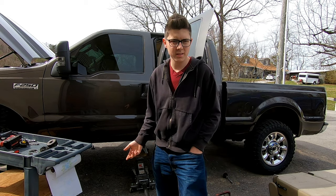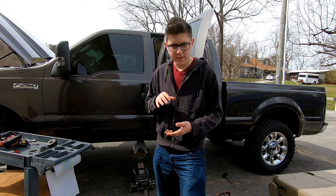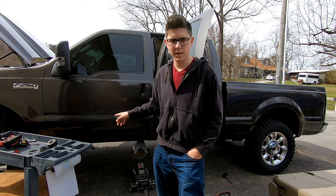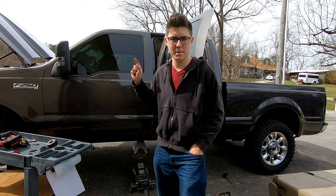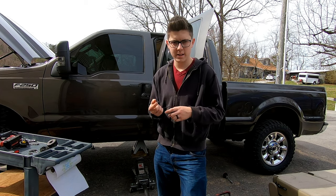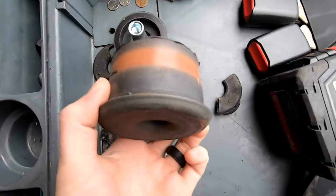Pretty much just removing the back seat is a little bit of a job, then you flip up the carpet and zip all the bolts out. On the 2008 and up, you're not supposed to use an impact gun on them, but on these you actually can use an impact gun — there are no cage nuts like on the newer body style. On the 2008 and up, I think you go from the bottom instead of coming in from the top. That middle bushing we finally got in from Ford.